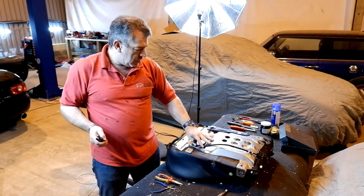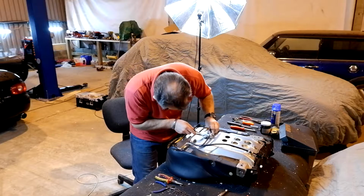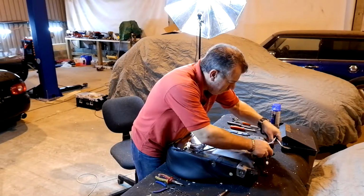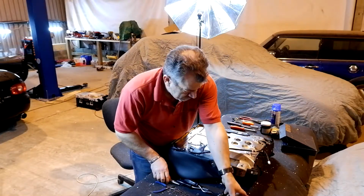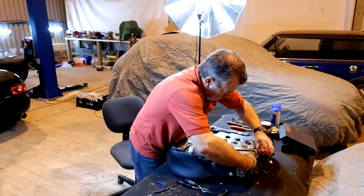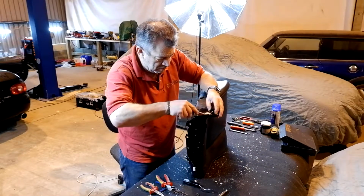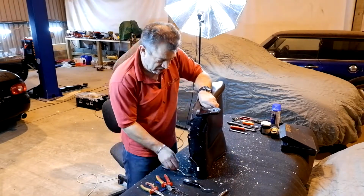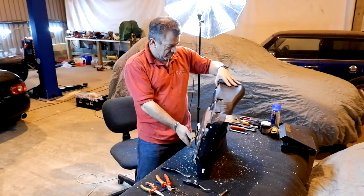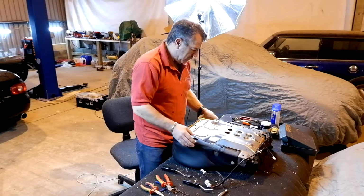Right, now once you've got that undone, you need to try and carefully remove the plug sockets off here for the heated seats and everything. So let's just move that. Oh, missed one. Next thing to do is to remove the pivot and remove the plastic cover. Now, from here, so that everything is loose, what we've got to do is remove the metal frame from under here.